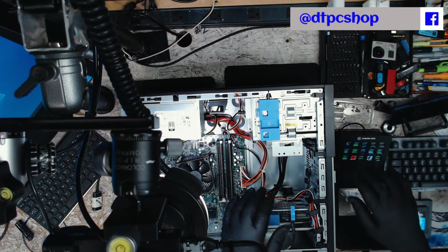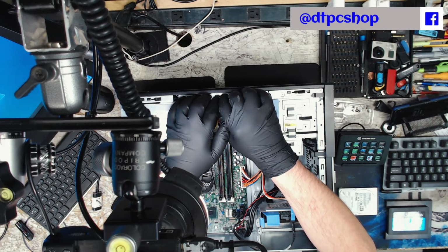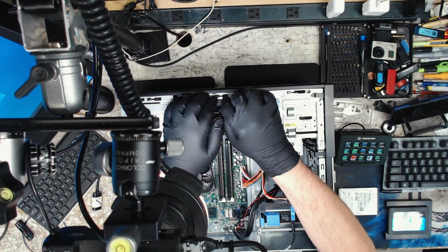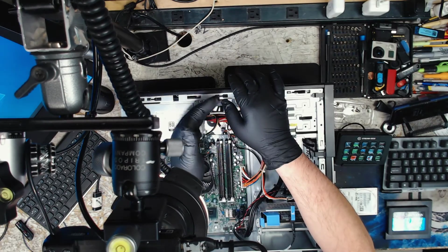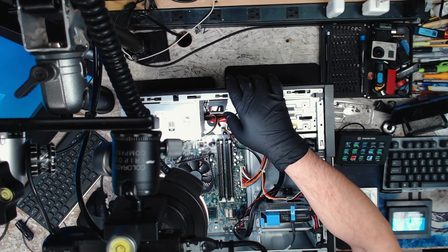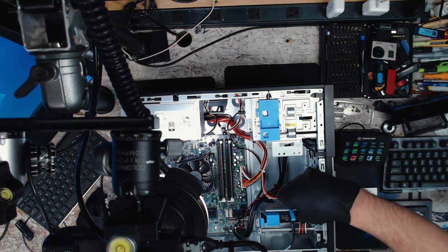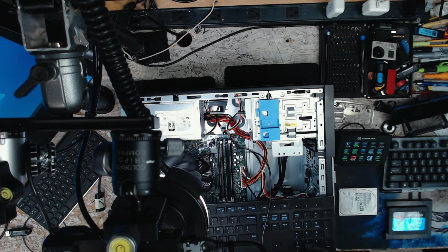Can we gloss over the steps of using the media creation tool to make the USB installer? Select make a USB installer instead of an ISO. If you have the ISO, you can use Yumi or Rufus to create your USB installer that we're going to boot here in a moment. I don't think I want to test this. We're not risking that. Not worth it, not at all. Give me a moment to get a mouse and keyboard so we can actually interface with this computer, and we're going to have to switch off of our all-in-one.